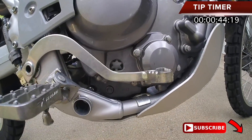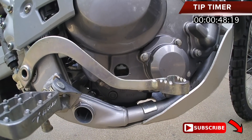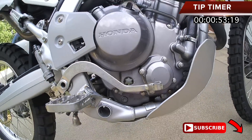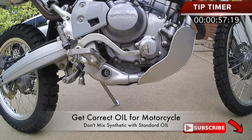What we do is stand the bike up, and if you watch, the eyelet fills up. That eyelet right there lets me know my oil level. If you're traveling on a moto trip, what you want to do is check that periodically, because every once in a while, engines do burn oil.